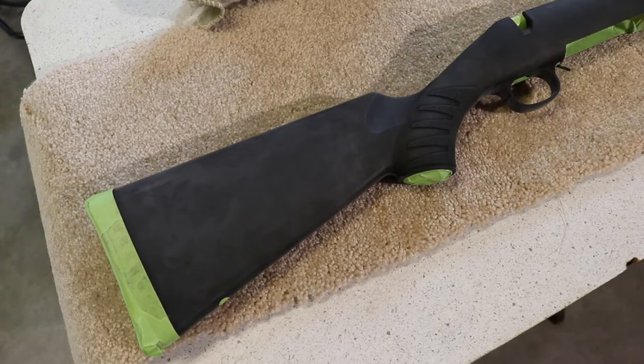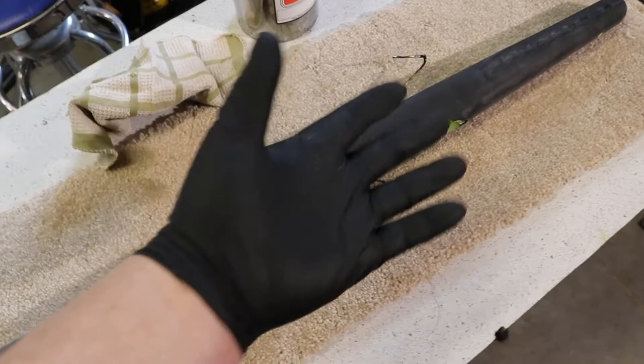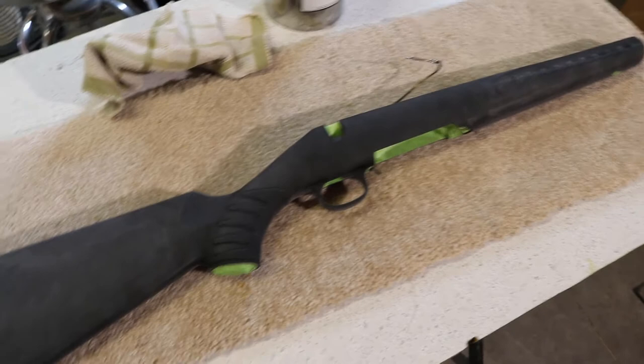You'll notice that the gun is darker now than after I cleaned it — that's because it's covered with oil from my hands, not motor oil but body oil. That's the next thing that can ruin any paint job. As I've been finishing my old Pontiac I have signs made that say 'do not touch' — not just for others but to remind me — because once you get to a certain point it's gloves. You're always wearing rubber gloves because paint won't stick to oil.